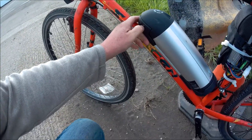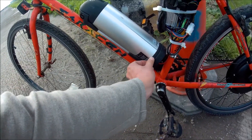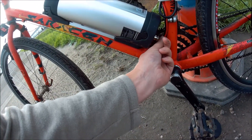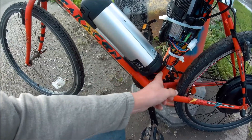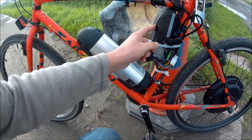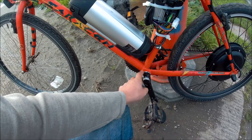You can unlock it here to take it off the bike. There's a charging adapter there — it came with a charger. I might be able to use my remote control charger as well, I'll have to look into that. That little bit at the bottom doesn't seem very well protected — I might have to cover that with liquid electrical tape to keep water out. These are the power cables going up to the ESC, which is just like a big ESC for planes really. You've got all the connectors here for the brake cut-offs; there are some extra ones that aren't used. I don't use the pedal assist so I didn't install that, although the kit does come with it.